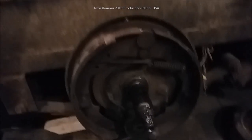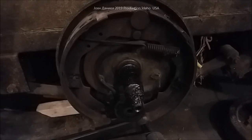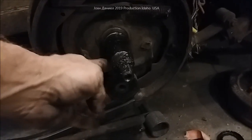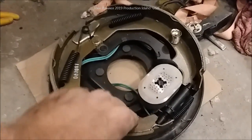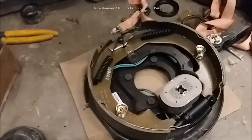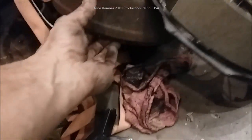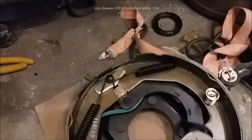This is Canadian-made, and of course when you get something made in Canada, it is usually a pain in the butt. What we've got is the standard little round quasi-oval magnet — it's just barely ovaled — and we're replacing it with the new more dynamic spring-loaded magnet that covers more territory. If you're wondering how an electric brake works, it just works by grabbing this material in here and expanding this arm, and what that does is cause the brakes to expand out.